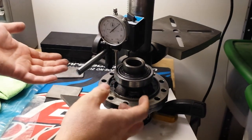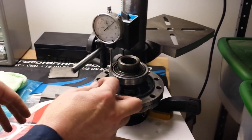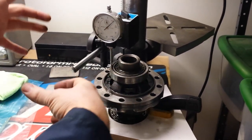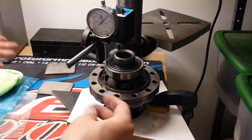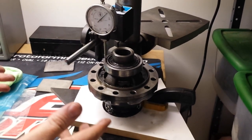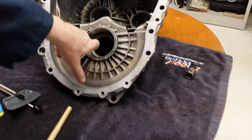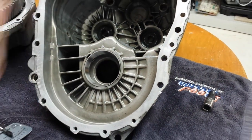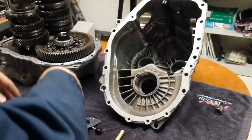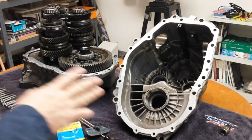That sounds pretty much like just the amount the bearings are going to wear in. The shims only come in two thousandths of an inch increments, and I was only off by one and a half in the direction of higher preload. I don't know if this is typical for most LSD swaps, but I was able to use the original shim — it seemed like the one that would be appropriate. Mine was a 1.05 millimeter, so I put that 1.05 millimeter shim back in, put the new race in for the new bearing, put everything together, torqued it down, tested the preload, and sure enough it was right at 17 inch-pounds of torque.